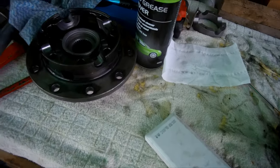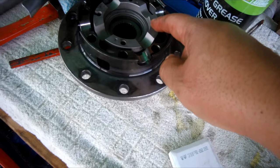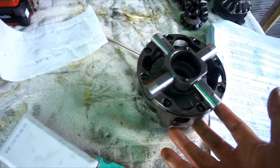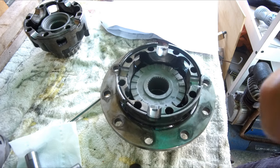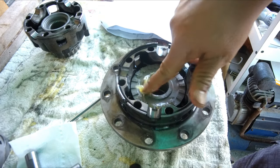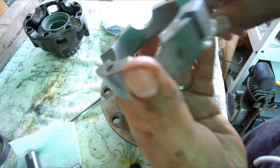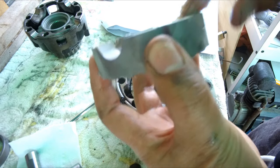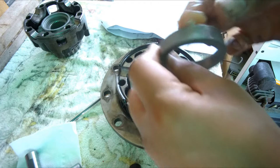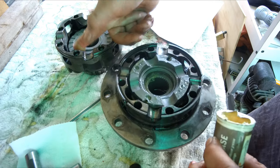So I think what it wants is to have one side, put all the cam, put the springs, and then assemble both of the sections, but without the cross shaft itself. So I'll do that. I'll start greasing all these locker sections, and also the holes so that the spring can sit without falling off. Grease the spacer as well. Then to the other side of the assembly.